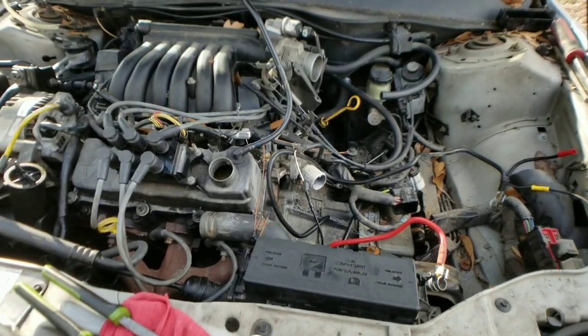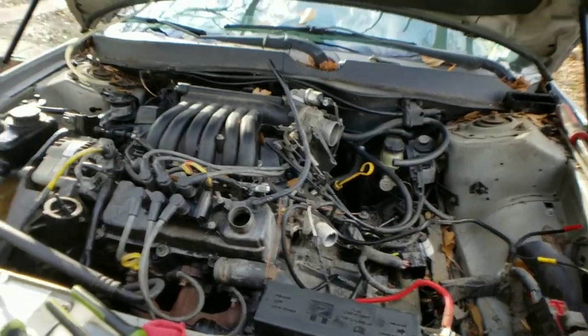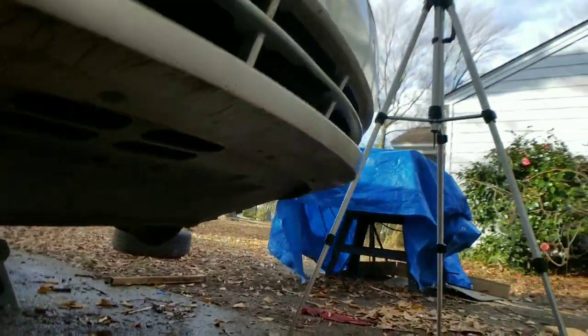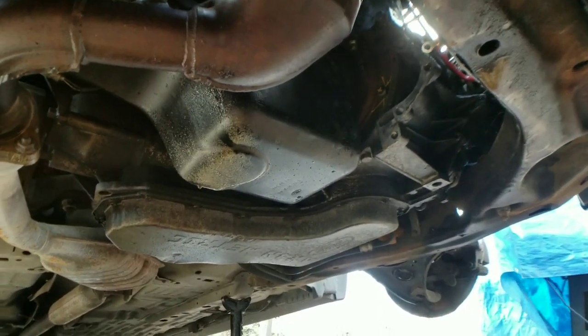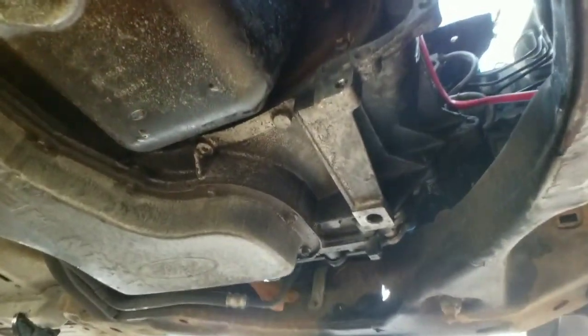We're underneath the car now. So I went ahead and took the oil cap off because I went ahead and drained the oil pan while I was down here. Get all that nasty oil out of there. I was just doing that because, I mean, I'm here and it has to be done anyways. All right, I took the starter out. It's gone. The inspection plate is also out of the way.